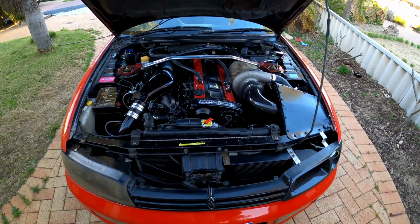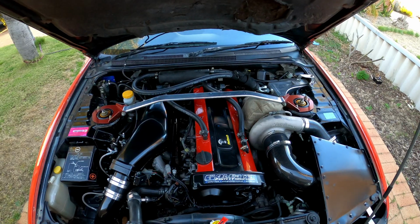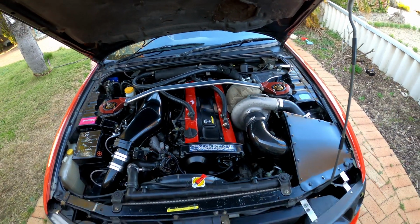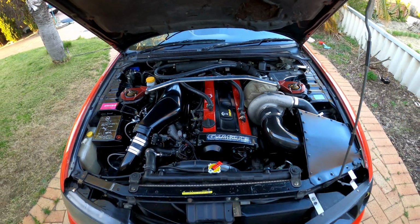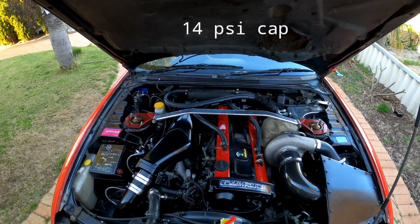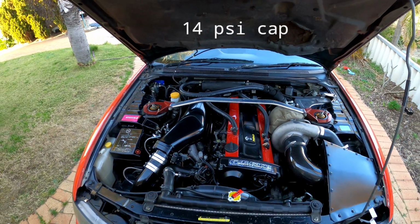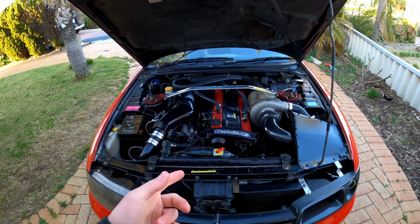With this cap on it, we retorqued the head to try and see if that would fix it. It helped, but still, with this cap and the retorqued head, at first run it accidentally overboosted and hit like 33 pound, and then coolant pressure jumped to 22 psi. So yeah, I'm just going to bite the bullet. The head's going to come off.